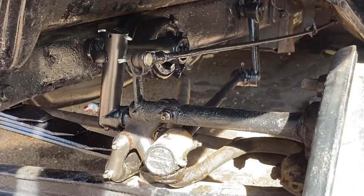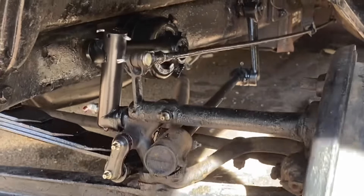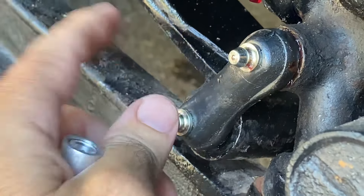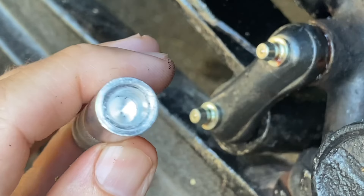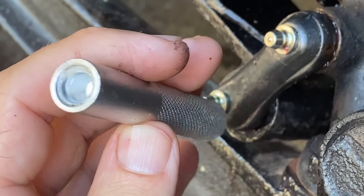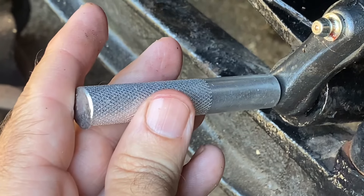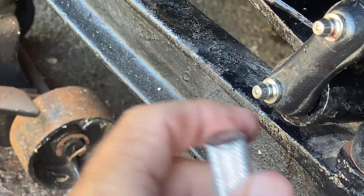Let's jack it up and put the tires on. I also added two knock-in grease fittings here, and I basically drove them in or pressed them in with a tool from Smith & Jones in Columbia, South Carolina — I'll leave a link in the description below. It just fits over the fitting and drives it in without damaging the outer portion.